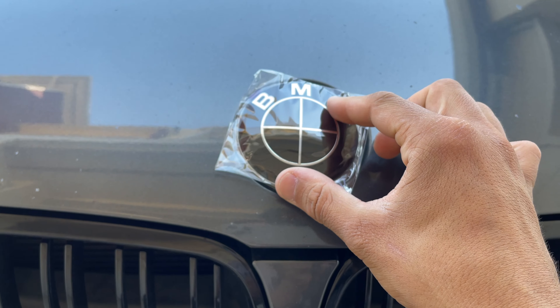We're putting on the backing portion and then installing the top part over it. I've swapped these out before but this one is discoloring badly, so we're removing it. What I did is put tape at the 12, 3, 6, and 9 o'clock positions with some overlapping on the inside — that's just to stop us from scratching the paint, which is the last thing I want. Now we'll go ahead and get our plastic pry tool and gently remove this. Be extremely careful not to scratch the paint.